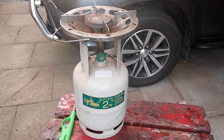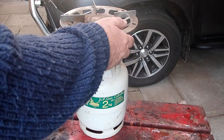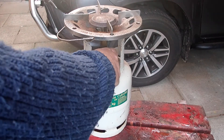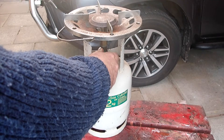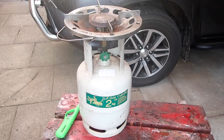I'll go through the process of elimination to diagnose what's wrong. The first thing I'm going to do is confirm there's gas on the cylinder. When I was a heavy duty fitter, there were many times I could hear gas coming out but the burner ring was not lighting - so there's a good start.